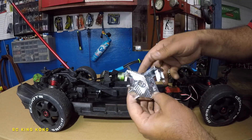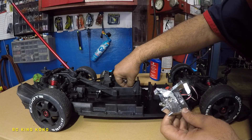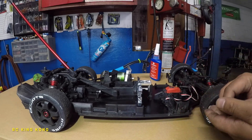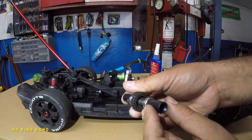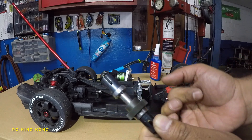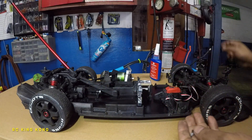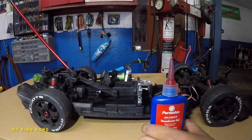We're gonna have the XLX2 going right here with some cap packs over here. We took off the mount brace from the opposite side and brought it to this side because the motor is coming this way now - the can is gonna be sitting over here. Here's our PPS mount - we're still waiting for the insert because the fifth scale big can is not gonna fit yet. We have three bolts from the stock mount. We got a Saga gear M1 8 millimeter 23 tooth spool. The shaft is titanium - it's not the stock shaft.